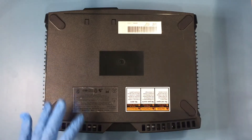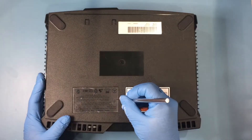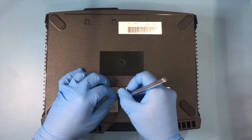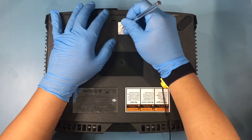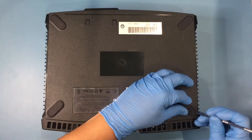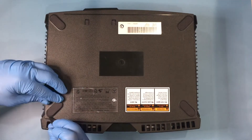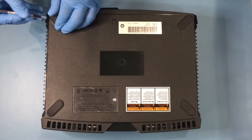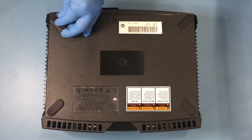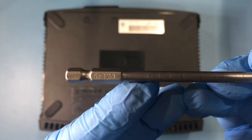For the surgery, two screws hidden by labels need to be exposed. I'm pressing in the area where the screw is to outline the area that needs to be cut with an X-Acto knife. I'm using a spudger with blunt edges to lift the rubber feet, only peeling back until the screw underneath is exposed, making sure the spudger gets underneath the adhesive of the foot. The six case screws are T20 Torx screws, so you need a T20 driver. I got these long security Torx bits from AliExpress.